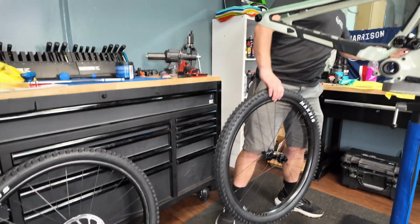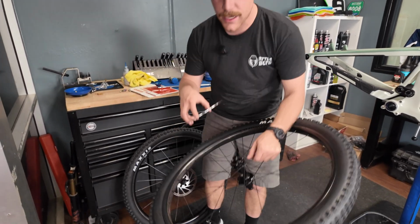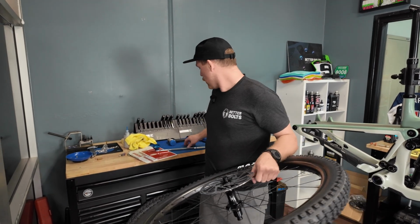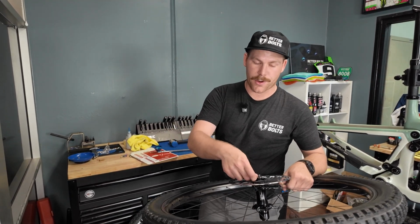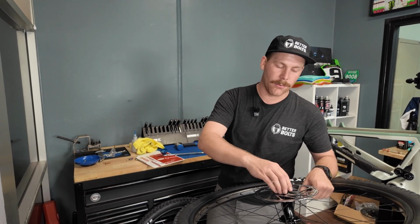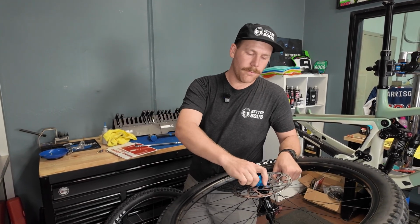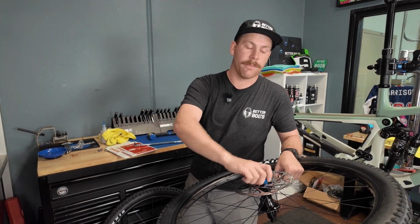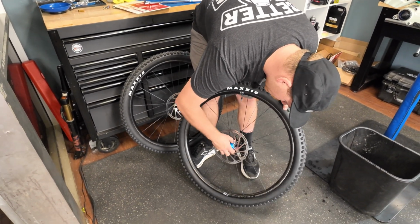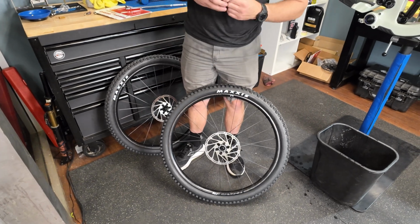Personally, this is not my favorite setup. Now this is where there's no right, there's no wrong. I like staggering my brake rotors. So I like to throw a bigger rotor in the front than I do the rear, or I will do something like Magura's trail brake setup where you'll have a 4-piston front, 2-piston rear, and then I'll match rotor size. But I tend to like, and this is just how my riding style is complemented, I like when my rotors are mismatched, but Chris likes having his rotors the same. On my XC bike, I do enjoy the mismatched setup. Actually, they're both 180, but I'm running the Magura MT Trails. Yeah. Trail SL. Trail SL.